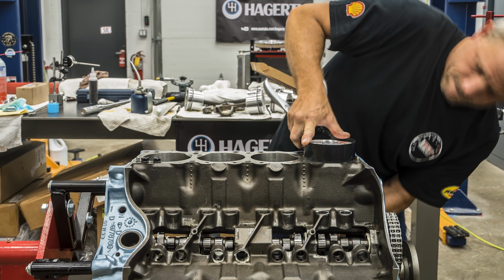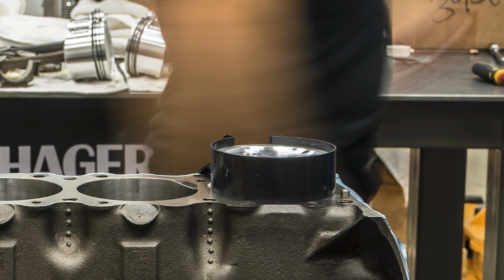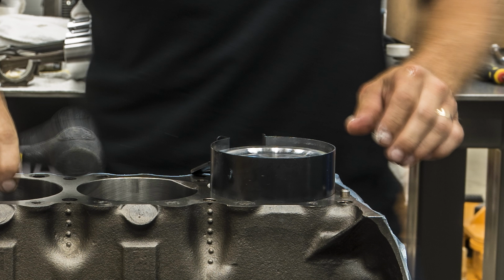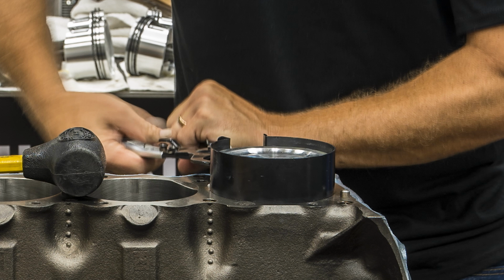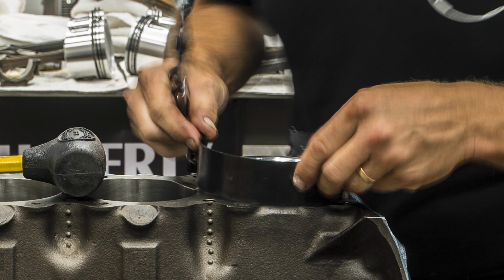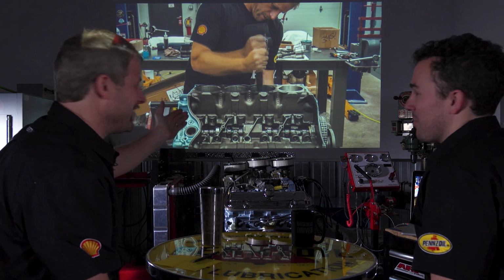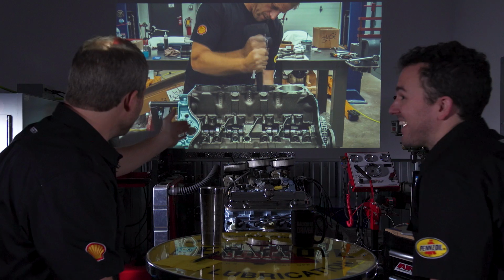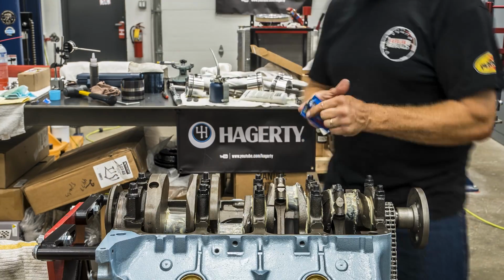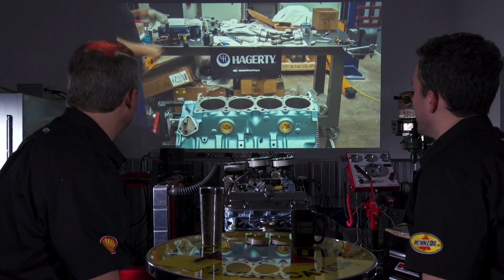There are about 3 different ways to put pistons in a hole with the rings, because you have to compress the rings so they slip down in the hole. Here we're using the OD clamp style and got frustrated with it. Some days it works beautifully, and I know it's all operator, and if it's all operator, then I'm surprised any of this works. I hear you. So our second choice was my old faithful adjustable sleeve, and that worked like a champ. So we got one bank.